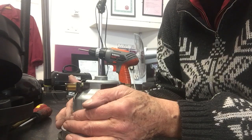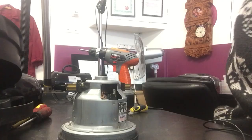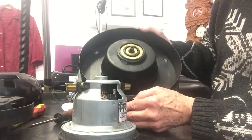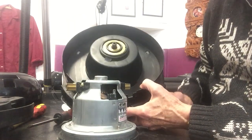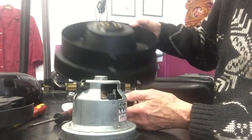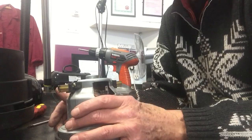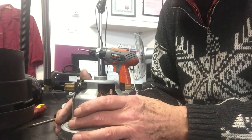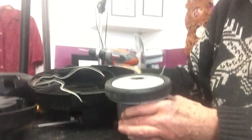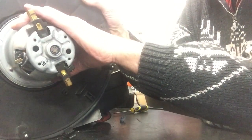We've checked the wiring because wires do come off sometimes. Look at this — a little wheel here. That's come from underneath the ring gear — these just drop in so that your ring gear flex coil holder can turn easily. Sometimes techs, if they lose one and haven't got a spare, will put it back without it — and you'll know because it'll make an unpleasant noise when you wind up and it sticks. This rubber collar here is to allow the motor to sit comfortably inside — if you've got the wrong motor it won't fit, or it'll be loose.